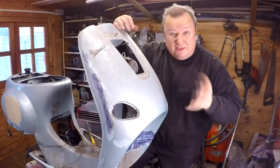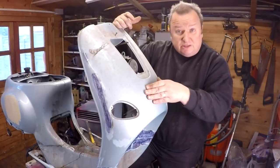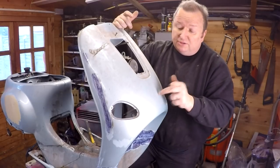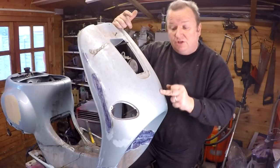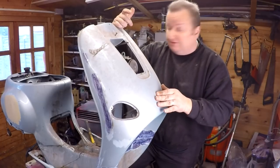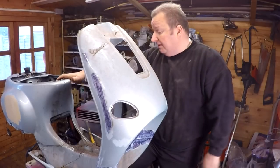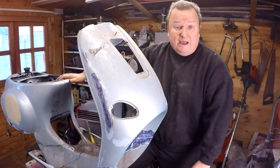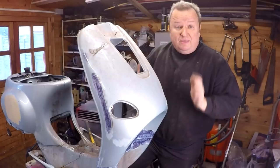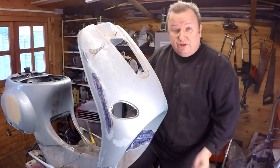So I think you get the idea on how we're going to progress with the bodywork now. The rest of the paint doesn't need any treatment at all apart from a gentle rub down. This is factory paint so there's no real need to remove all this — it just needs preparing for a new base coat and a new primer. So I'm going to go over the whole lot now, give it a good key up and a good clean up. Hopefully when we come back the Vactan will be dry and then we can carry on and fill in the little bits where we need to.